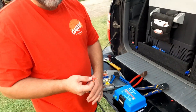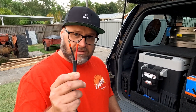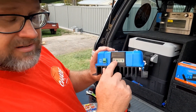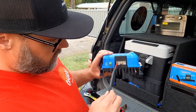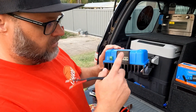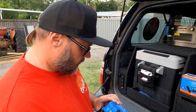Now you might say, 'But Matt, why do I need a boot lace? I just twist the cable and stick it in.' Well, this way stops any little strands fraying out. Because what can happen with these terminals — and a lot of terminals — see how close they are? If you jam your cable in there, especially if your cable's a bit bigger and it's only just big enough to fit in there, you're gonna hedgehog it. And you can get strands that go across and that'll bridge out and short your unit out — could even cause a fire. So spend a couple bucks, get boot laces, do it properly.